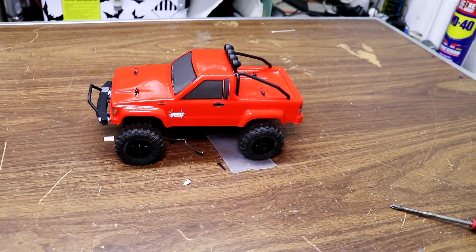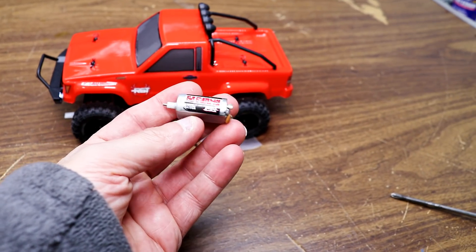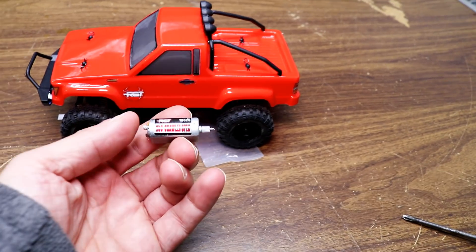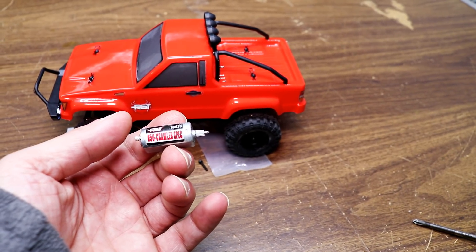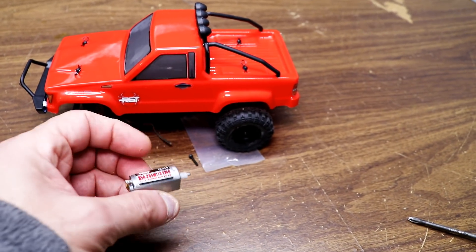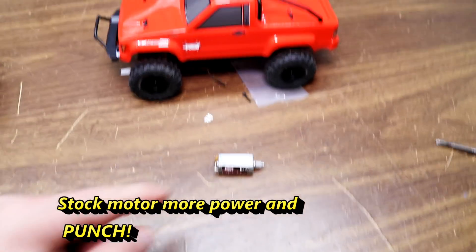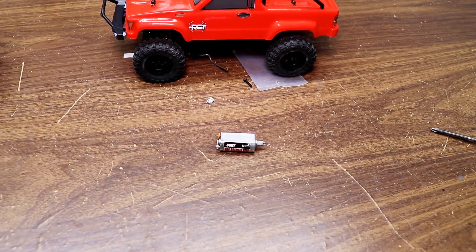After testing it, I seem to like the stock motor better with the same tooth pinion gear. I think the bigger can, the longer can with the longer magnets — when I turn it I can feel it has more pop in the magnet. If you could get the 8 tooth pinion gear on it I'm going to try next, hopefully that would be the best way to go. This one works — if you just want to pop in a motor with a 10 tooth pinion gear to slow it down a little bit, it'll work, but bigger is better. That's it, motor test. Thanks for watching, we'll see you next time.